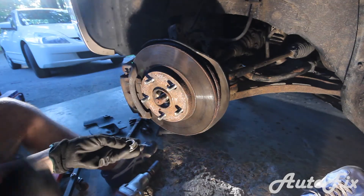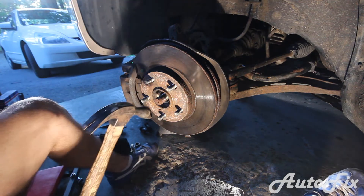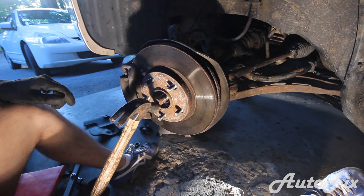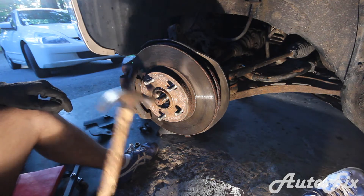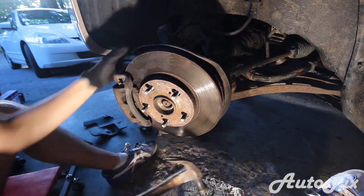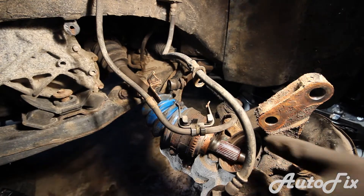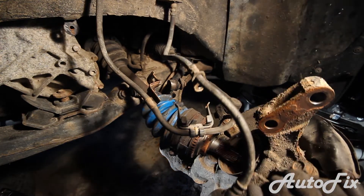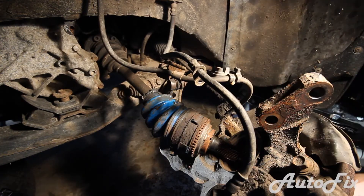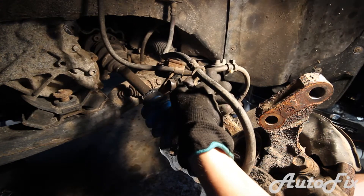Off it comes - that was a little bit easier than the other side but still pretty tough. Typically if you're reusing this axle you do not want to hammer it, but these are clicking which is why we're replacing them, so we don't care - it's a hammer. There you have it, it's out. Just be very careful with the ABS sensor - they're very sensitive to shocks and the wires are thin. Be careful that when the knuckle comes down from the suspension it's not still attached to anything.